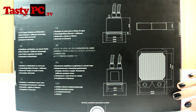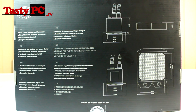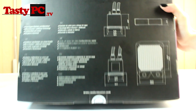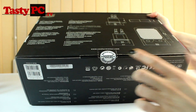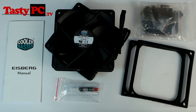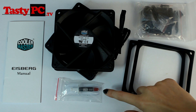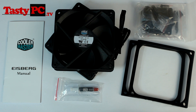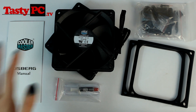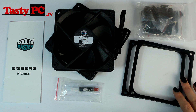Another highlighted feature is that it's been factory filled and sealed. The dimensions are shown here, and one thing to note is that the water block slash pump is very big. Lastly, it's been sealed by an AlphaCool sticker. Inside the box you get a user manual which includes a fitting guide, the fitting kit, and a small tube of thermal paste — because the cooler doesn't come with thermal paste pre-applied. You also get two fans rated at 1600 RPM, 60 CFM, and 20.5 decibels, plus two anti-vibration gaskets.